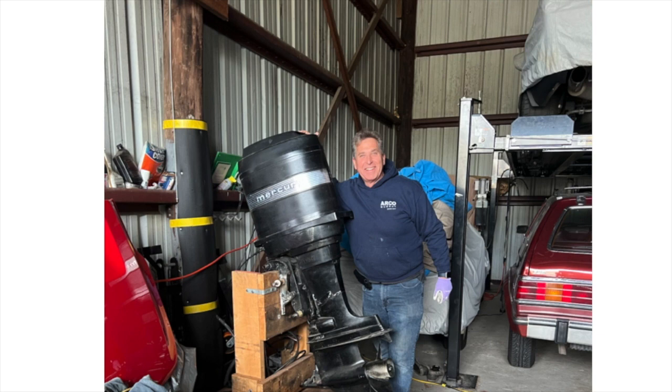When I picked up this inline 1978 or '79 115 Tower of Power as a backup and teaching tool, I had Mercson L6 check it out when he delivered it. He delivered my '79 functioning 90, and he took a moment to appraise this for me. He hooked up the controls, turned the key, and nothing but crickets. It turned out the internal harness was botched, and many of the wires weren't even connected.